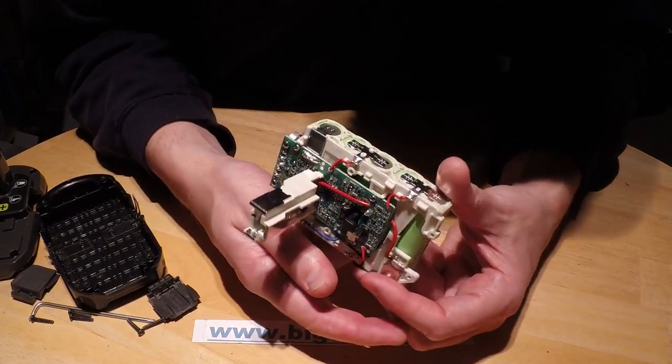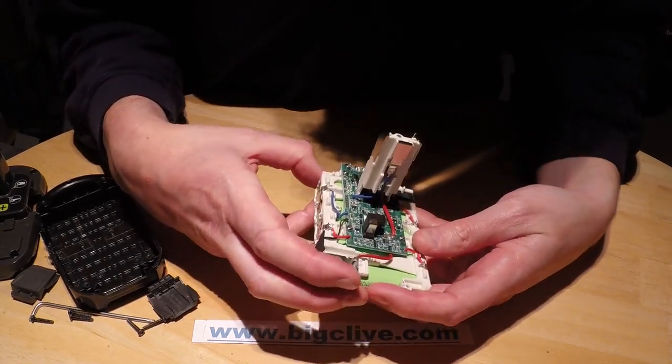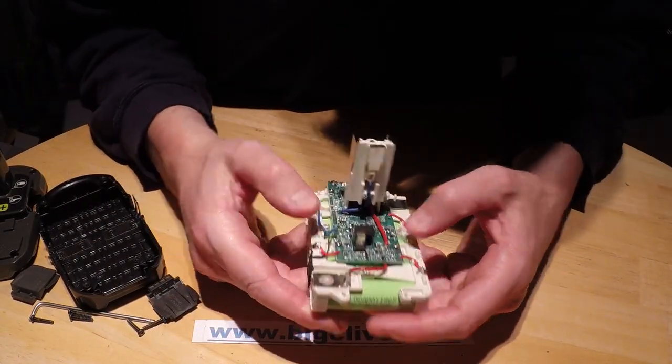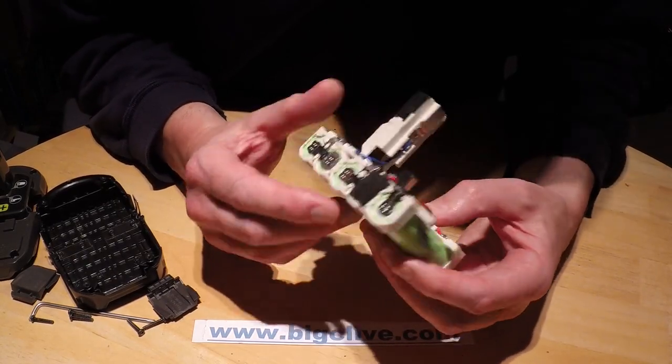This link on the positive is quite odd — it has a big hole through it with mica underneath for heat resistance. I wonder if that's a last-resort fuse that just physically blows the link open, because these things look like they're capable of really high current. The whole cell system actually just screws together as two blocks.